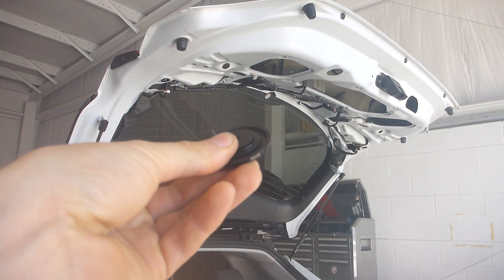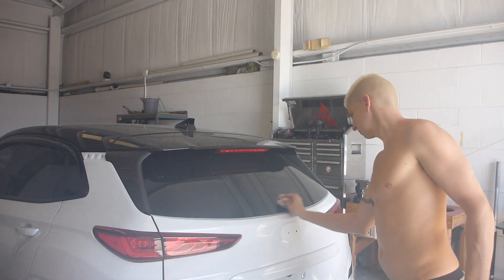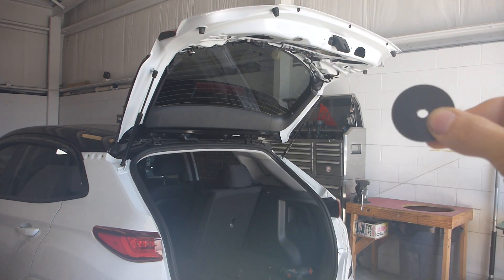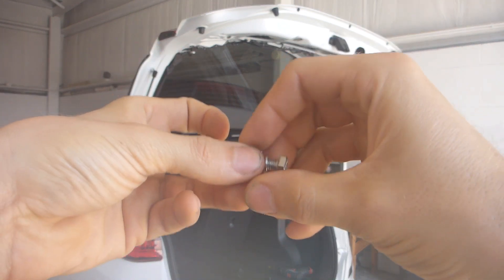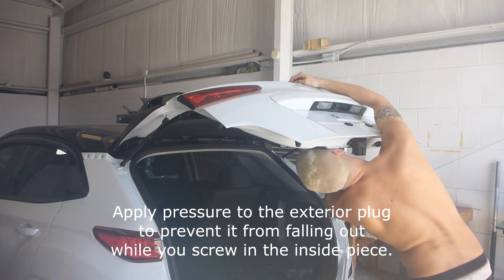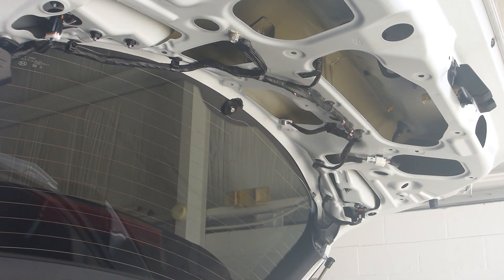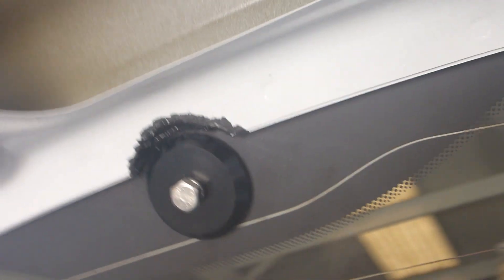We're finally ready to install the plug. First, take the plug and the gasket and mate them together — it fits right in that seal. Close the hatch door, wipe down the glass surface so it's clean, and place this oh so gently into that little hole. Open it back up. I've got the backing plate and the gasket — those get mated together. There's the single screw and the lock washer, those get mated together, and the screw goes through that hole. This part will be easier if you have a friend, but it can certainly be done alone. To tighten it, I'm going to choose not to use the impact and just use a good old-fashioned ratchet, so I have a little bit more control over the amount of force. I really just tightened it enough that the lock washer was compressed, because that pretty much guarantees that it is not going to unscrew itself.